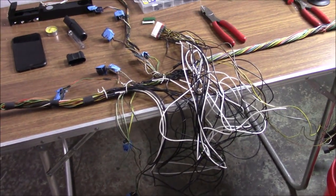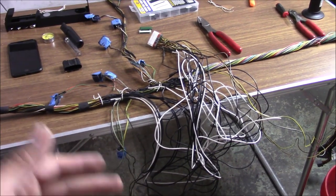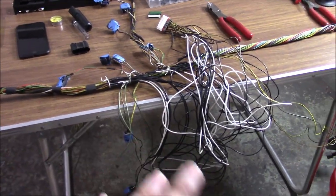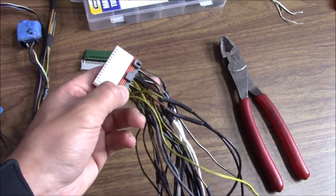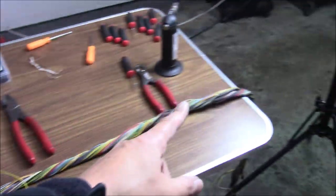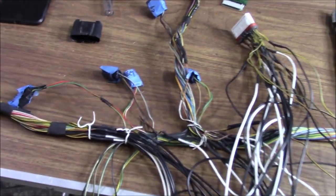I just looked at the time — I've been in this garage four hours straight doing this harness, extending these wires. I didn't even realize how long it's been, but when you're doing stuff like this time flies by so quick. I finished extending them — I want to show you my idea. I ran out of black wire so I had to use some white wire and actually had to call Carter to bring me more black wire. I started to take the covers off the junction block again because there were like three wires in this junction block that actually pulled.